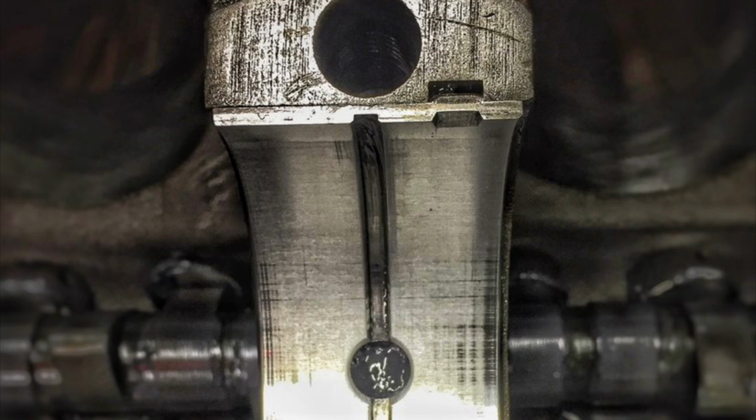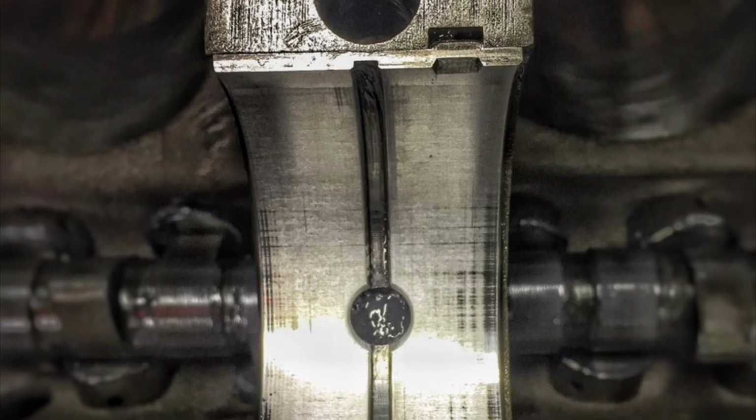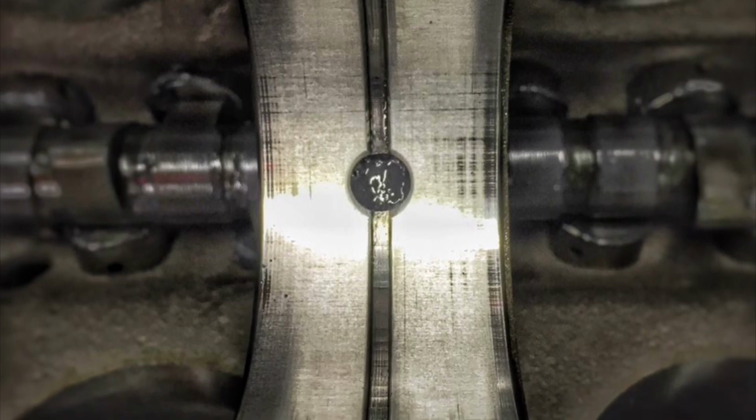So here we have major setback number 3. The crankshaft never felt quite right as I was rotating it through, checking valve clearances. Felt a little bit tight. Keep in mind that this is only the second motor that I've ever attempted to assemble. So I pulled the crank and did a visual inspection of the mains, noticed some scuffing.